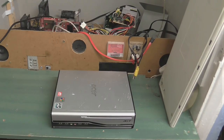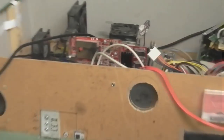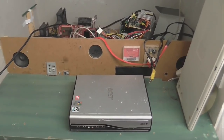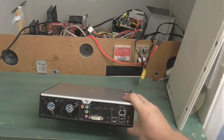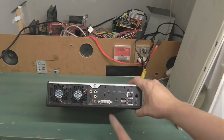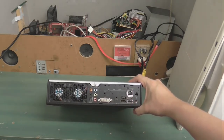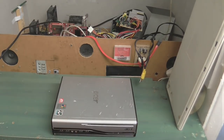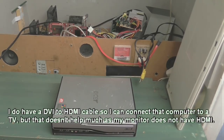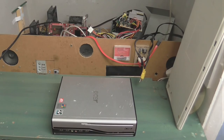There is also no video capture on this thing. I've got a nice video capture card in FrankenPC which I got back in 2004 and that still works like a charm, but I could replace that with a USB capture card, no problem. The only other real issue is that there is no VGA on the output — we've got DVI, Ethernet, audio, power, and USBs, but no VGA, only DVI. I'm sure I've got a DVI cable floating around somewhere. I know this does work because I put FrankenPC's hard drive in here, turned it on, and the computer powers up. I hoped it would boot from that hard drive so I wouldn't have to reinstall Windows, but nope, it's not having that.